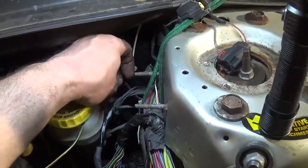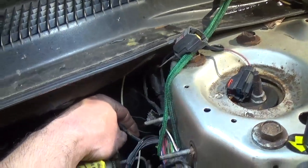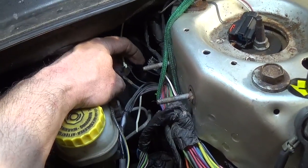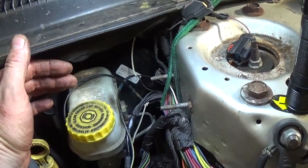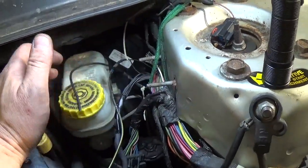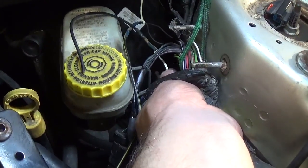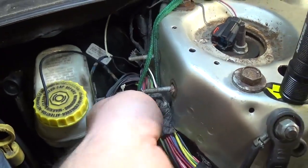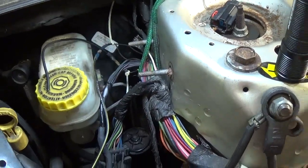This was very, very difficult. I am concerned about these two wires going into the firewall — I trimmed it as far back as I could and still could not get to the best wiring. These two are okay, but these other two I can still see the black crud on them and they're kind of stiff. That's the best I can do. Now I'm going to put the shrink tube over this and then connect it back together. I put a zip tie around the wires to keep them straight and to keep the tension on it so I can put this shrink tube over it. This is the shrink tube that has solder in it. It'll be okay — it's just very aggravating work, but it'll be fine.